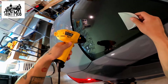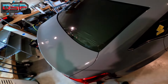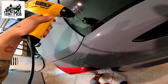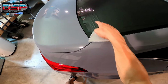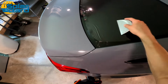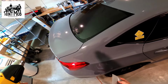Another one, side to side, and keep moving. Keep moving side to side. You don't want any of those aggressive lines, and I'm gonna show you what an aggressive line looks like. So that's already good, but if I keep going, you see those hard, aggressive lines? That's too shrunk, that's too much. We're past the wiggle, and now we're going into aggressive lines. That makes it harder to lay down, and that also makes it harder to install. Okay, so we want to avoid that.